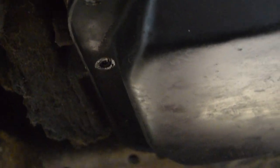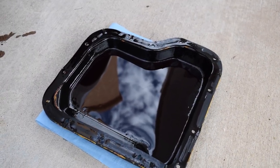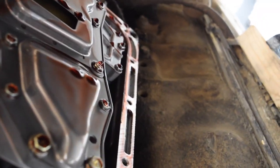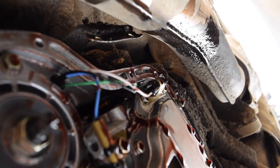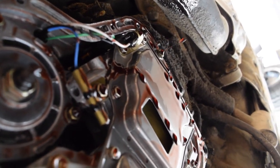You want to wear some old clothes — stuff you're not afraid to get transmission fluid on because the stuff is pretty nasty. We've got it off. Under here you can see two things: there's one bracket that holds on some lines, and up over there there's another bracket that flips over that. I just get a flat blade screwdriver and pry it out of the way. Mine came off pretty easily — it looks like it's hinged on the lines so don't push too hard, but it should rotate.